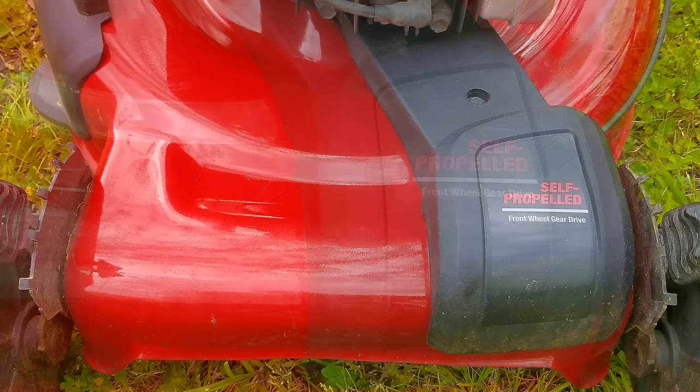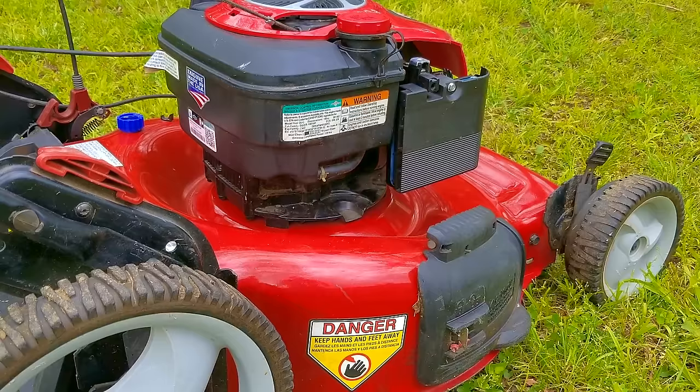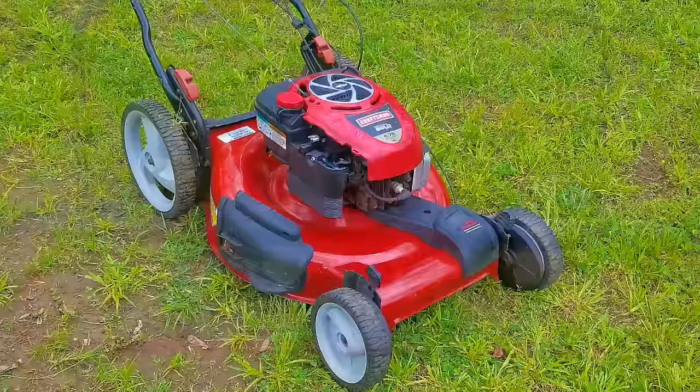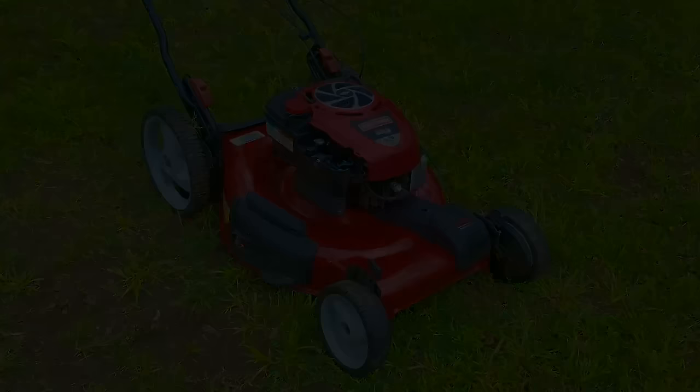Another option as to why the engine wouldn't start is that the ignition timing is off because the blade has made contact with something like a stump or a large rock. First confirm there is a gouge on the edge of the blade, and if there is, replace the key on the flywheel and the ignition timing should return to normal. So my question is: how often do you check the oil in your mower? Once or twice a year, or possibly once a decade? If the previous owner had taken better care of this mower, they'd probably still have it and not give it away. Thank you for watching — please feel free to ask me any questions about this project or your own projects, and I hope to see you in the next video.